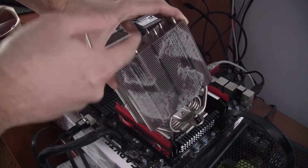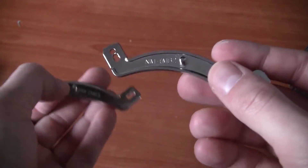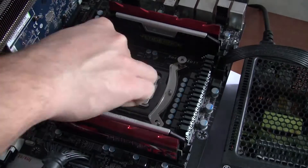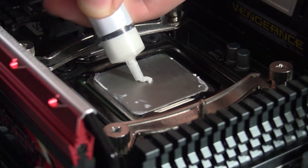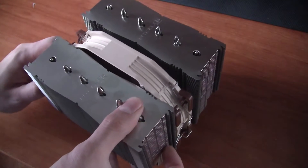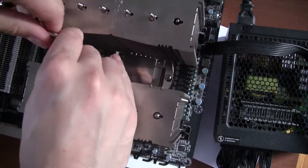This is a reminder why you need to clean your cooler often, especially if you have an open test bed. One thing though — the holding brackets are a bit different in hole spacing. The NH-U12S uses the NM-TMB3 holding bracket, which is different from the NM-TMB2 from the NH-D15, so we had to swap them out. That's a minute or two, nothing too complicated. We applied Arctic Silver 5 thermal paste on our Core i7-3970X Extreme processor. This thermal paste is on par with Noctua's NT-H1 but needs a little break-in time, so there could be a degree or two difference at most. After that we pulled off the middle fan to access the screws and pin down the cooler to the socket, then put the cooler down, spread the paste, aligned the holes, and screwed down the cooler evenly on both sides.